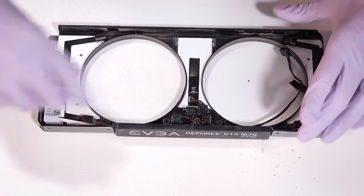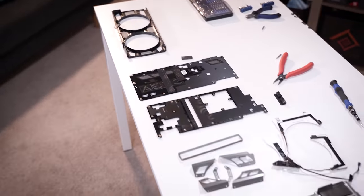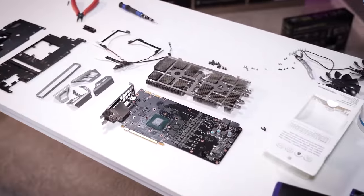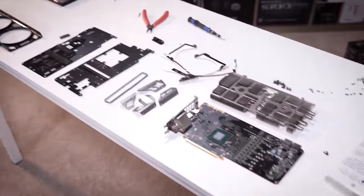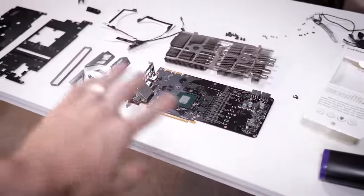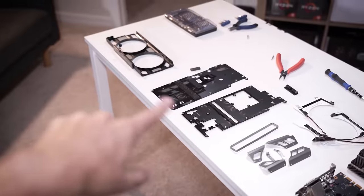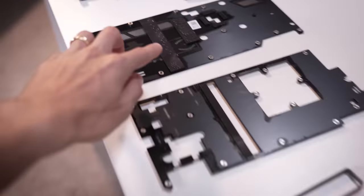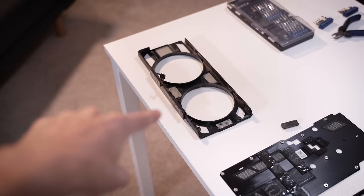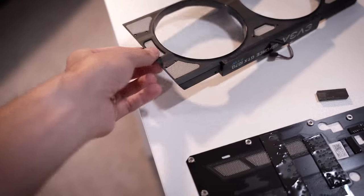After a few smaller details, we now have everything laid out on this desk — quite a bit for a single graphics card, and yes, one of the more worst-case scenarios. But this is important because now we can properly clean. We'll start first with the PCB, get that out of the way, and then start cleaning the plastics and the heat sink. The heat sink is what we'll probably want to use water for. We can also use water for the plastics and other metal bits, but there are some thermal pads we still need to remove before we do that.